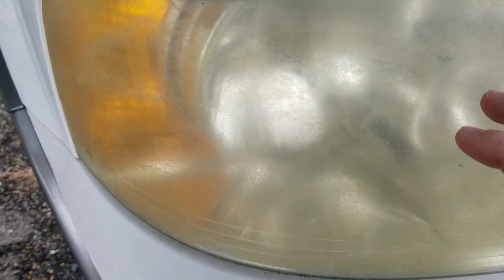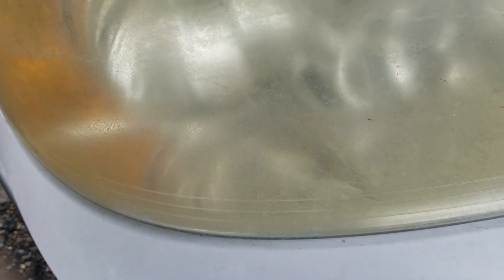The fading and discoloration came back because it boils down to these cracks formed in your plastic headlight cover from UV damage, and both those methods only temporarily filled them. I even got in here with a drill and tried polishing with toothpaste, but you're not going to get the abrasion needed to remove a lot of these surface cracks. It was clear for a while until the headlight got wet and the toothpaste washed away, and the discoloration came back.